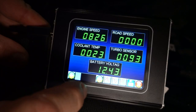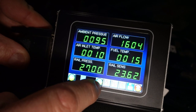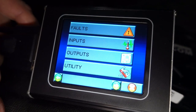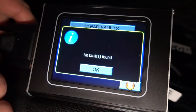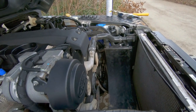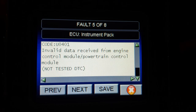This device will allow two main operations, which are: first, a real-time access to data not available on the dashboard based on the sensors of your vehicle, for example, the turbo's pressure, the coolant's temperature, or the air intake's temperature. And secondly, it gives the possibility to read and clear the fault codes, which will automatically remove the engine warning lights on the dashboard. This can be very practical, especially if the fault has been physically repaired in the meantime.